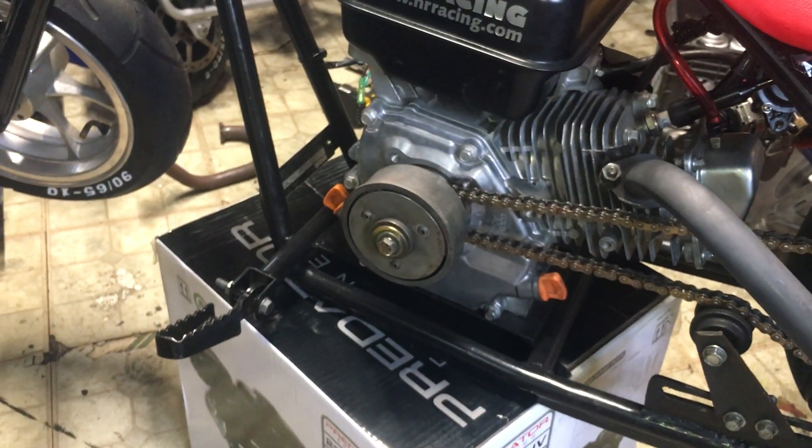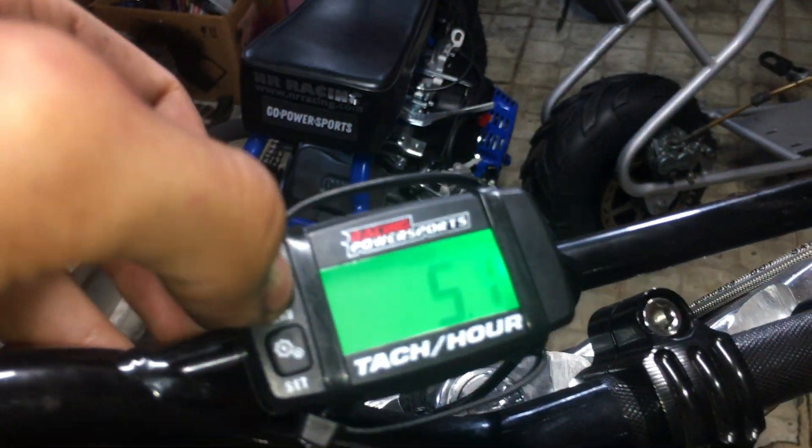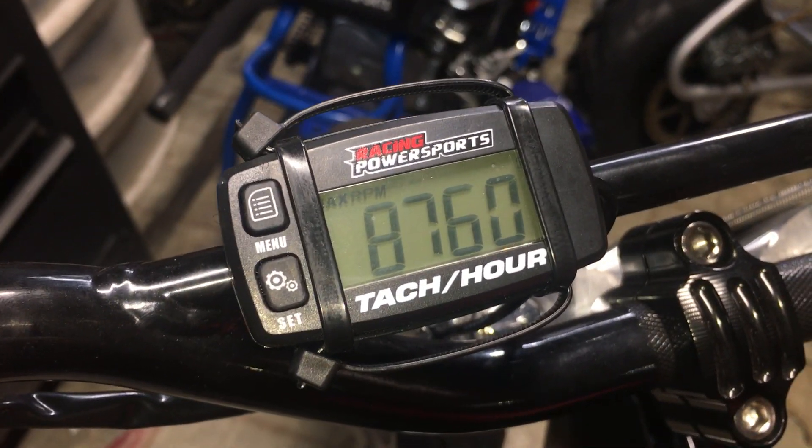It's a Premier Stinger clutch, and I'm turning just under 8,800 — like 8,760 RPM. I recommend this tach from eBay; it's only $20 and gives you a lot of options. Don't get the one made for two and four stroke — those things are garbage. It's a Mikuni adapter with a Walbro fuel pump — that's a must. And a 26-millimeter Koso $30 carb from eBay.